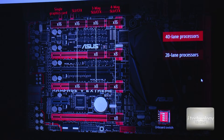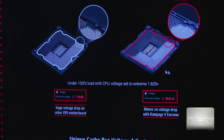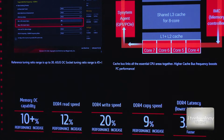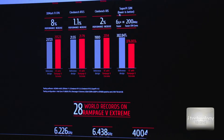If you see guys, the CPU socket is designed with more pins — the reference design, the normal design, and the Rampage 5 design. It has a lot of pins compared to a standard mainboard because it supports up to 1.824 volts. ASUS tells us there will be no voltage drop with this Rampage 5 Extreme. You can overclock your memory — if you have standard 3000 MHz, you can push it further with overclocking and see these values increasing. You can boost your RAM. Here are some benchmarks ASUS provided.